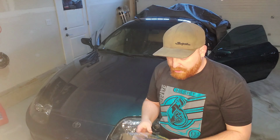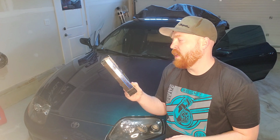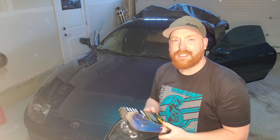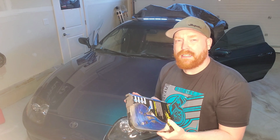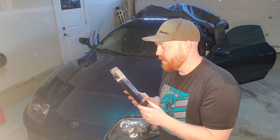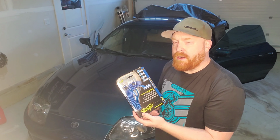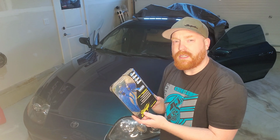So the first thing I'll be doing before I lay the carpet down, I'm going to reroute some brand new top of the line Stinger RCAs, because the ones that are in there now, it looks like they were cut and reconnected at like 2 or 3 different spots. So I don't know how you could do that with RCAs, but sure. So that's what I'll be doing here, and I'll also be making sure that the power wire to the stereo is routed correctly, because it isn't right now, so I'll be doing that as well.